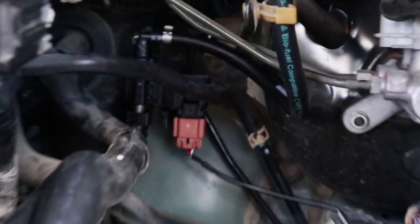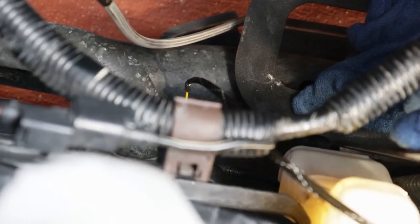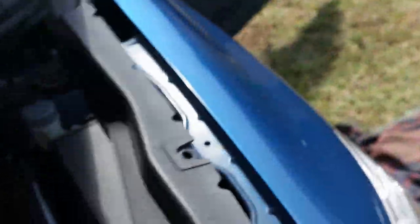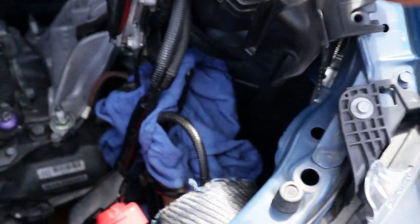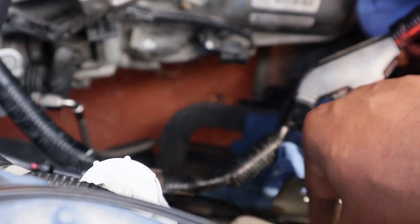So this is how I routed mine: it goes this way around this wire holder and comes up right there, going underneath this little channel part, into the fender from down there into the little grommet hole. Then the part that connects into the coolant sensor is routed going this way up and right here. I put this little piece back and you won't even see it anymore. I'm gonna get some zip ties to zip tie it down so they don't move, and zip tie this into this harness right here. Should be good to go.